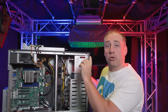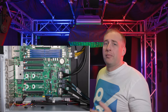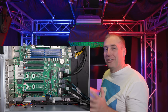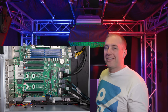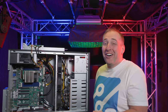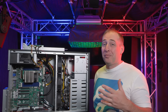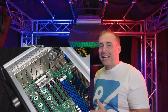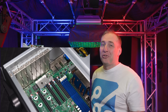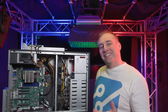Not only do we have that slot on the riser we showed earlier, but we also have a main block of PCIe slots — five PCIe slots here, though we effectively used four of them because we used double-width NVIDIA A100s for testing. Most of these slots are double-width spaced, because Tyan is assuming if you buy a server like this, you'll most likely have a double-width GPU or accelerator. One fun little detail: the I/O expansion slot covers in this system are totally solid, not vented at all — ensuring airflow goes through the accelerators. They also have mounting holes, so if you wanted to add something like a SAS controller, you'd have the mounting points to do that.